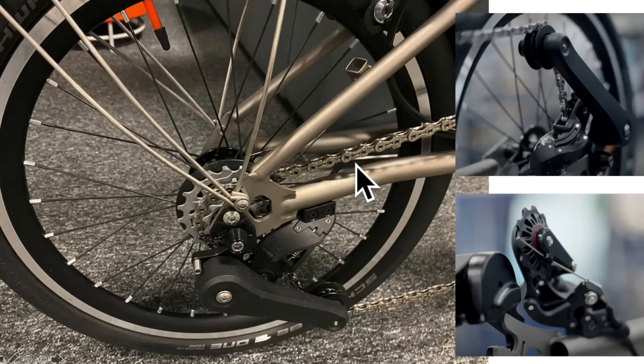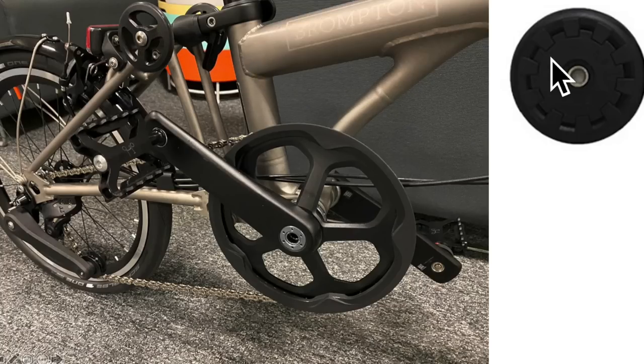They also went for a hollow-pin chain, which is lighter, but at the same time if you're riding through mud, you'll collect mud in it and it's not fun to clean — be prepared to use your old toothbrushes. They also cut weight on the easy wheels, but there are sacrifices: the rubber ring is relatively thin, meaning it can only go on smooth surfaces. A small pebble could chip it away. I definitely prefer the old easy wheel with thicker rubber and higher clearance. A thicker rubber couldn't be used here anyway because it would pop off when you turn. They also included the P-line suspension block, which is stiffer — a good balance to the titanium frame, which also offers some flexibility.